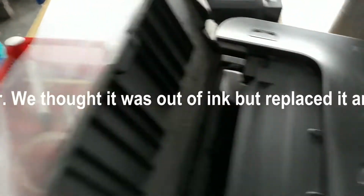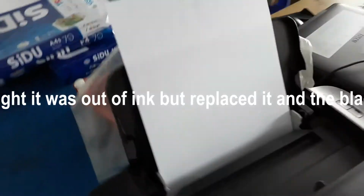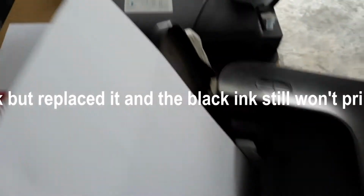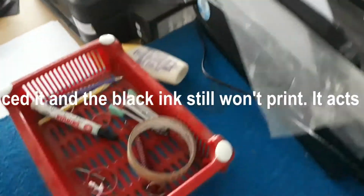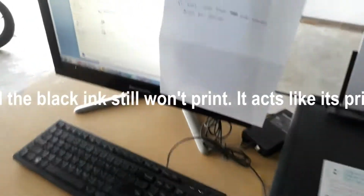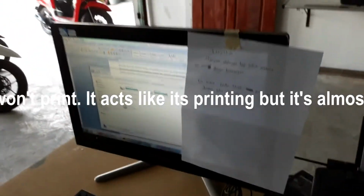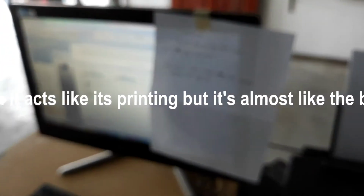Did you remove the little piece of tape on the bottom of cartridge? I was having the same problem today. Ran carriage underwater and dried. Still didn't work. Looked under tools menu on the printer screen and noticed clean cartridges. Chose that option. I guess it did the job, because it ran a test print, and when we tried to print again it worked just fine.